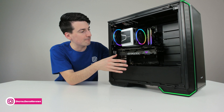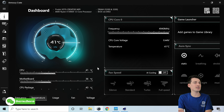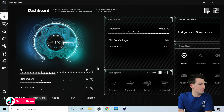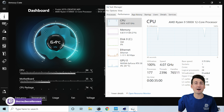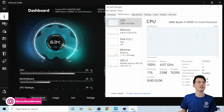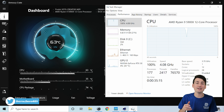The PC is built — everything's working great. Now let's check the temperature and see how the cooler is doing. At idle, our CPU is around 42 degrees Celsius and our motherboard is showing 36 degrees Celsius. We do have the tempered glass panel on, so the case is fully enclosed. Now under full CPU load for over five minutes, we peaked at 65 degrees Celsius and it's now holding steady around 63–64 degrees Celsius. The cooler is working great, and obviously so is the CPU.